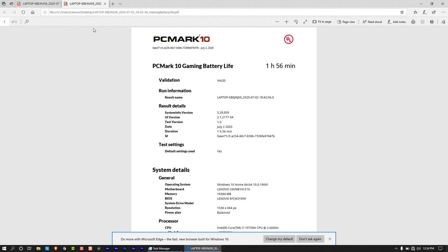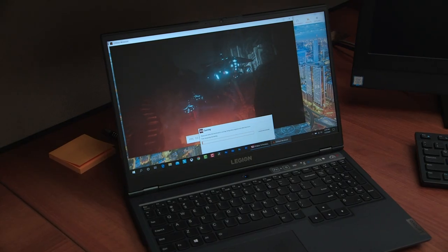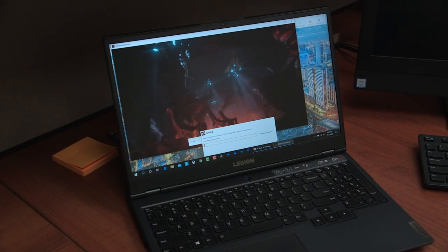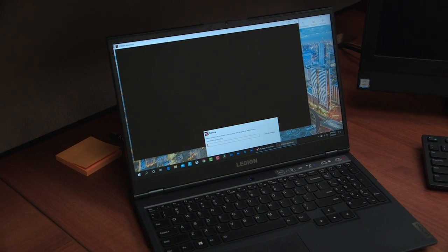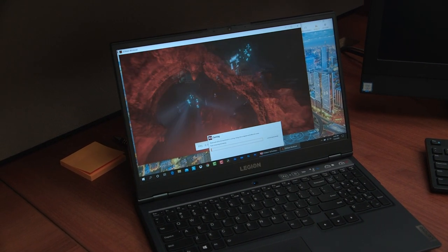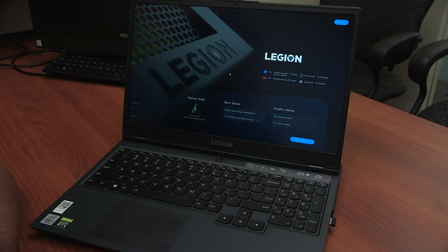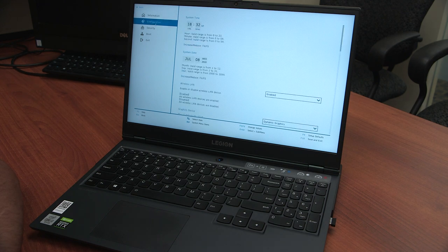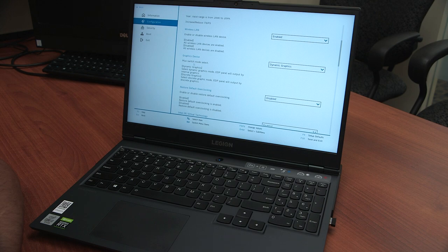If you're trying to game on this machine without being plugged in, you're going to get a lot of lag — your frames per second are going to decrease because the graphics card needs that juice. Running only on battery on this particular machine, it just sucks. You are able to boot into advanced startup and get inside BIOS to configure the graphics card to discrete or dynamic. By default it is configured to dynamic, but I've read that changing to discrete can mess up the system, so just be careful how you configure it.